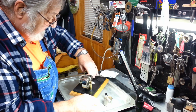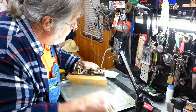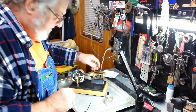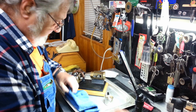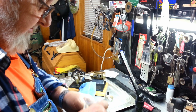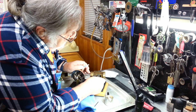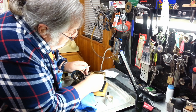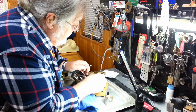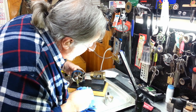Now we're going to turn this thing around a little bit and let's see what we've got right here. She's a little bit nasty right there, ain't she? There we go, we've got it clean now. Maybe we'll wipe that down a little bit. We'll do a little bit of cleaning on that intake right there and we can use small Q-tips on that. I'll just wash it down a little bit. That alcohol will dry. You don't want to put no oil on here because that oil and that graphite would make a mess — they'd be gumming up. That's why these motors don't like oil. Graphite is a lot slicker than oil. I believe we've got that down there timed just right.